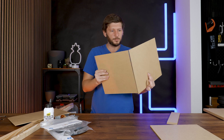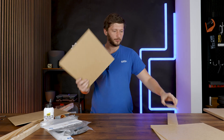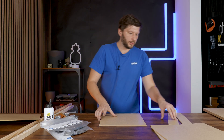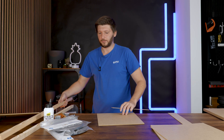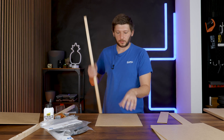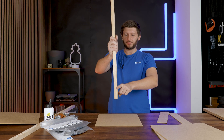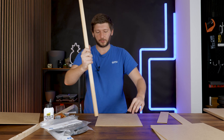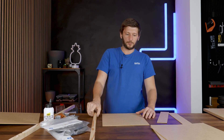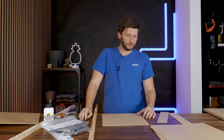So this is the bottom of the whole construction and this is going to go here. How will I mount A to B? I know these here are 65, so what I can do to help the bottom construction where the PSU is going to be is to cut off exactly 65 millimeters of this one, four times, and then position it on every edge of this panel. That should give me the support needed to mount down the bottom.